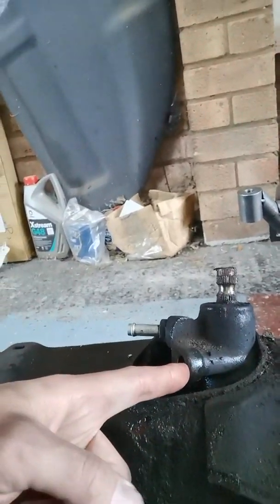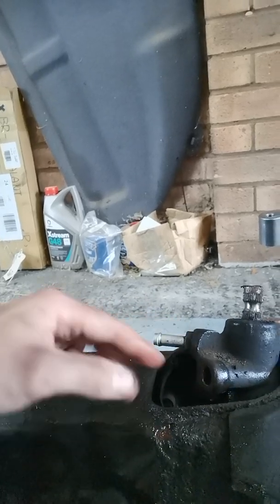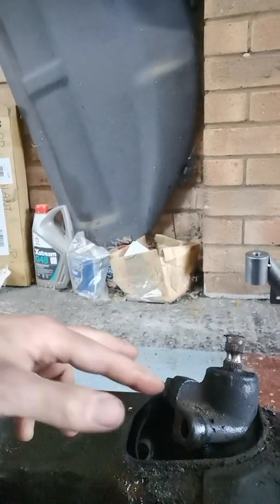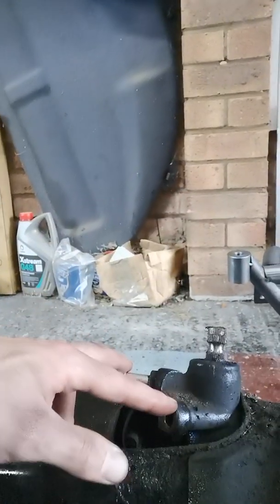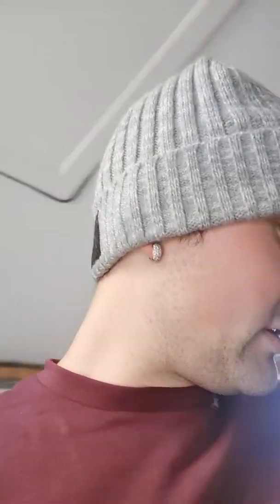Another thing I noticed which was weird is I have a 420A Eclipse at work, which I use for a lot of the mock-up for suspension and such. The steering rack on that one, I think is a '95, is different than the one on my '97. It only has one threaded port, and then it has a low pressure side push-on hose, whereas my other one has two threaded sections here. Well, this is a threaded section, but it has a hard line going off of it like it's a high pressure line, and it's metal all the way along on both of them at work. So I'm not sure of the difference on this one, but I don't know if they redesigned it or not.